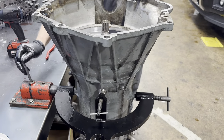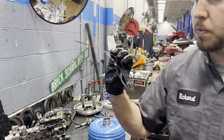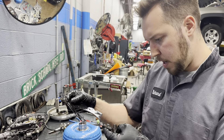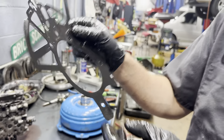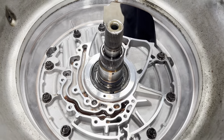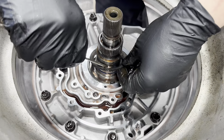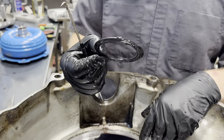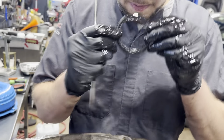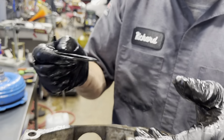We're going to rotate the unit this way, and then we're going to pull our stator support gasket out of here — that's new. They did a good job with that. I've never seen that on an OEM or AC Delco one. Then we've got a washer — oh my gosh, that's melted! Look at that guys. I thought that was sealant originally, but this is melted. This washer is not supposed to look like that — not supposed to be that thin and flat. That's weird.